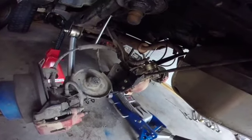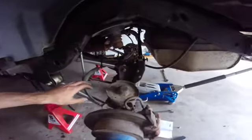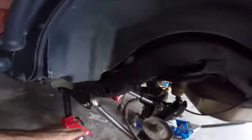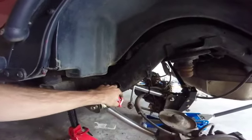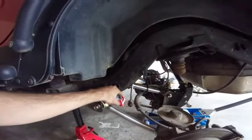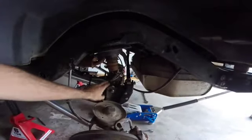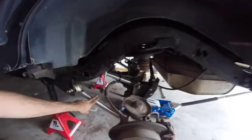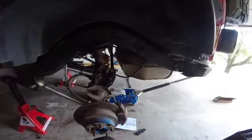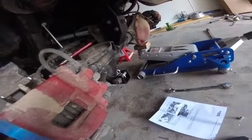Yeah, I guess next would be the upper control arms again. And we're almost there. Alright, so all the control arms are installed. It takes a little bit of effort. Note with the uppers now, they come with new bolts. You can go through these holes in the frame, make it a lot easier. So the uppers are all going to get tightened to 55 foot-pounds, and all the lowers are going to get tightened to 130 foot-pounds.